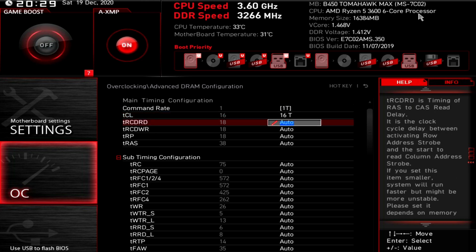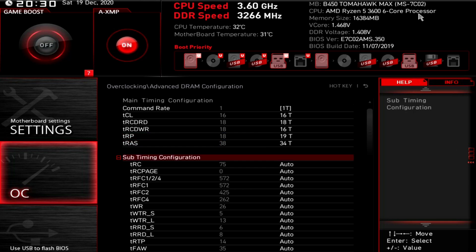Once we're there, we're going to want to find advanced DRAM settings and change our timings to match those from the DRAM Calculator. People tend to do this step very differently. I personally will punch in all of the timings shown on the DRAM Calculator and then see if it boots normally. If it does, I'll go straight into MemTest86 and do my stability test. If everything passes with flying colors, I'll do some more stress tests like AIDA64 and do some gaming.